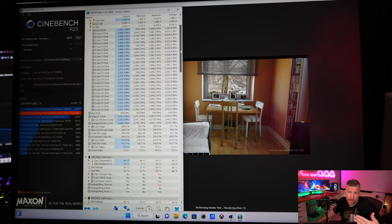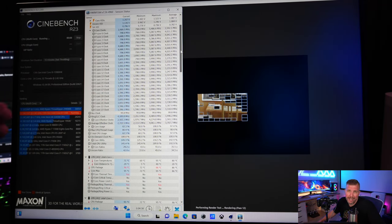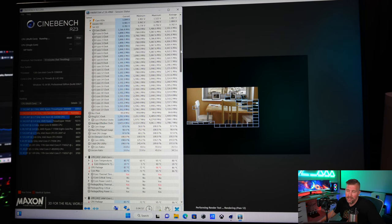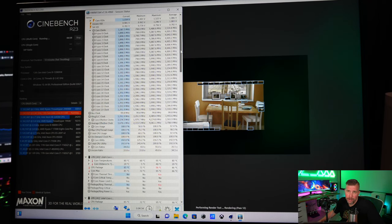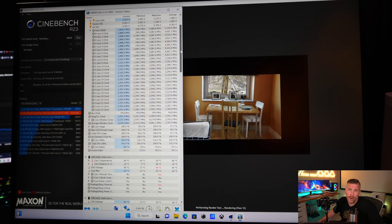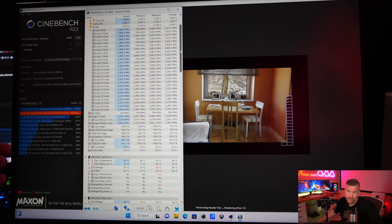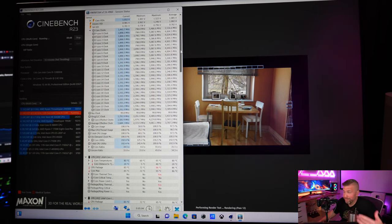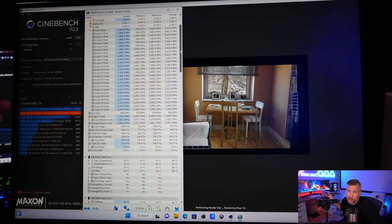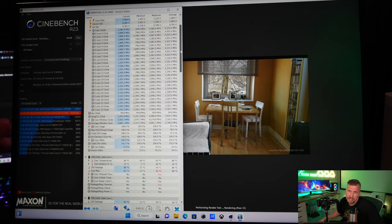which is more than four times stronger of an undervolt. And Asus just doesn't let us undervolt more than 30 millivolts, which is kind of silly. I think they should at least let the user try to go to at least 100 millivolts undervolt. Personally, that's what I'm thinking. I don't know. I mean, I'm curious about the logic behind minus 30. I mean, very few laptops will fail at a minus 30 millivolt undervolt. Some might.